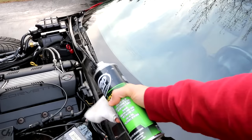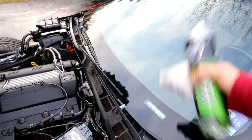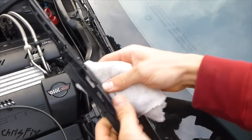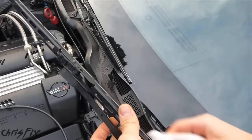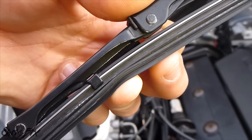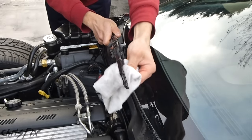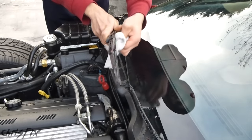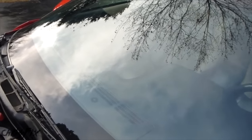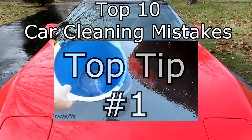The top tip for this video: always make sure you clean your wiper blades, because all that hard work cleaning the windshield will be wasted once you use dirty wiper blades and spread dirt all over. Spray glass cleaner on a towel, pull the wiper blade up, and run the towel along the whole blade. Many people say use alcohol, but alcohol can dry out the rubber on the wiper blade and cause it to scratch your windshield — so just use a glass cleaner that's safe on rubber. Do the other wiper blade as well, and you'll keep the whole windshield from getting dirty again. Thank you guys!